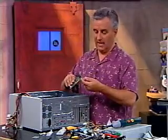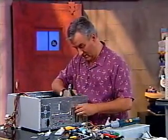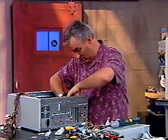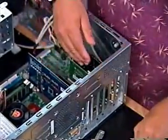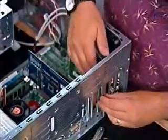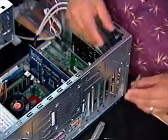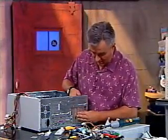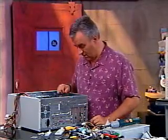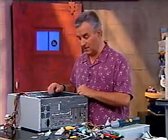I also have a modem and a network card. We are just wacky today and I'm going to slide mine in here. And there we go. I've got one opening that I am not using, so I'm going to push this back in to fill it up so that I don't leave any holes in there. But we're done. We're going to screw these things down and make sure they're solidly in there. And we've installed our additional cards. We've got everything installed for the case.